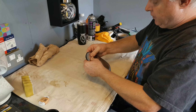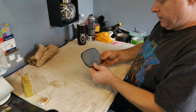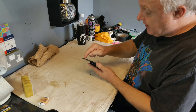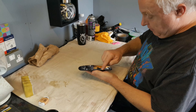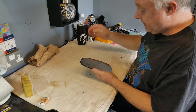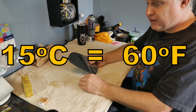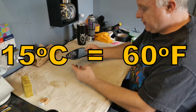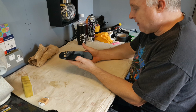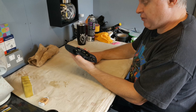Apply some thumb pressure all over and especially around the edges. If you feel the need, with a little black or suitable colour of silicone sealer go around the very edge and fill in to waterproof it, but if you've chosen a good contact adhesive that should be waterproof anyway. If the temperature outside is under 15 degrees then I suggest putting this in a warm place for 24 hours before refitting it to the car. If the temperature is up around 20 degrees centigrade then go ahead and fit it straight to the car.